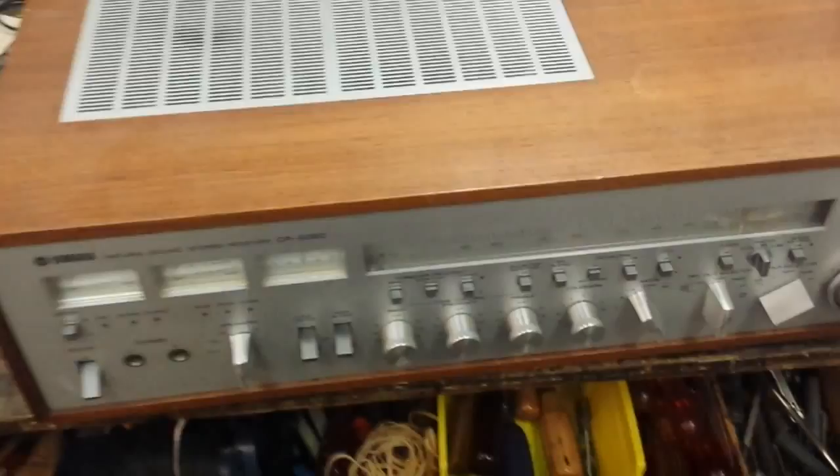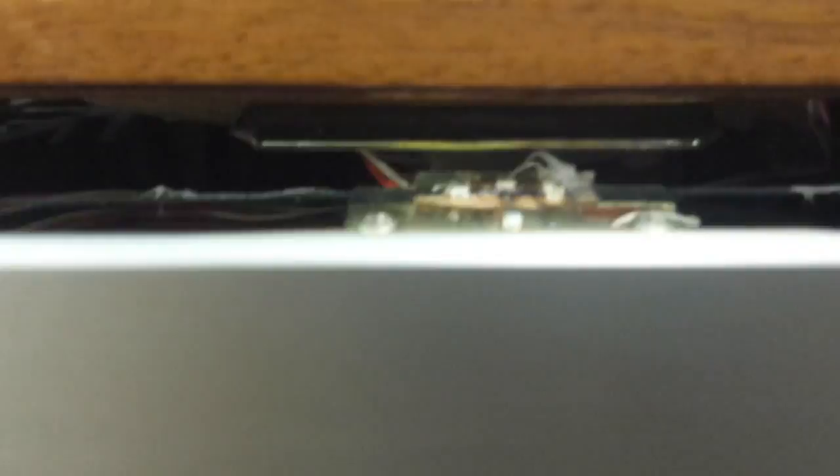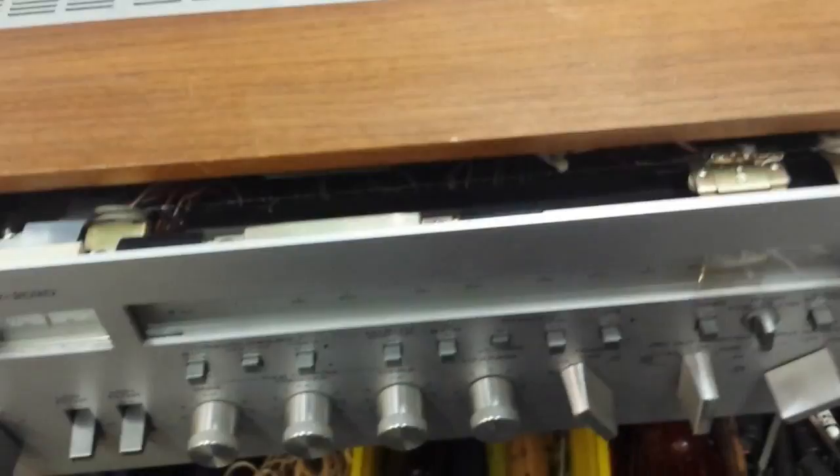As we slide it out, you can see the fancy little bracket there. If you move the tuner, the dial pointer and string coincide with that bracket. If you try to push it back in, there's a very good chance the tuner string will get caught up on that bracket and that means the death of your tuner string. When you take these out of the case, just crank the dial all the way to the right and that will solve the issue.